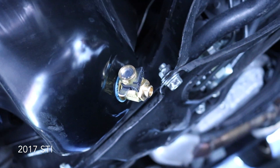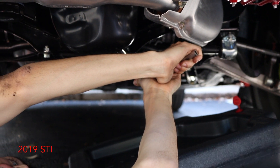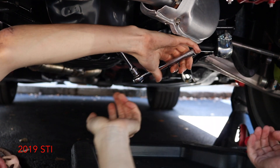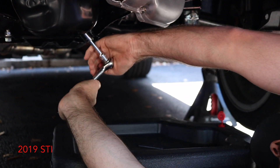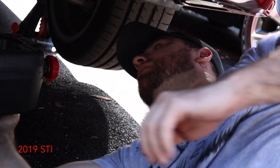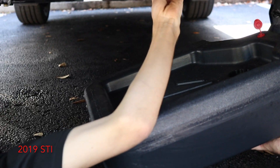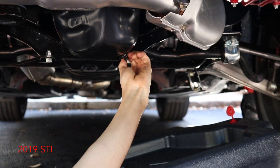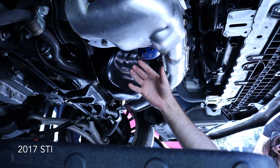The safety clip is on so it won't accidentally drain your oil. To open the valve you've got to use some muscle — push action does it. There we go! The oil is coming out — angle your hand away because it's going to spit this way and it might be hot. It dropped. Next we're going to loosen the oil filter and let it finish dripping.